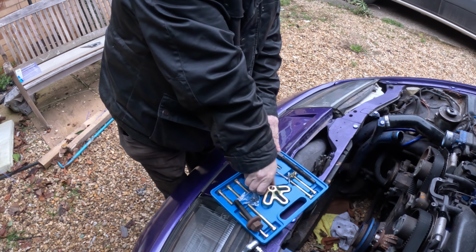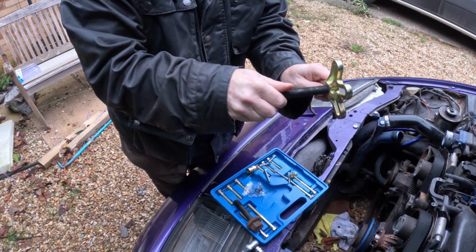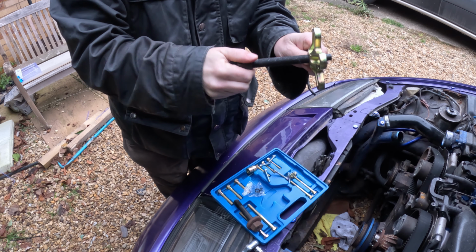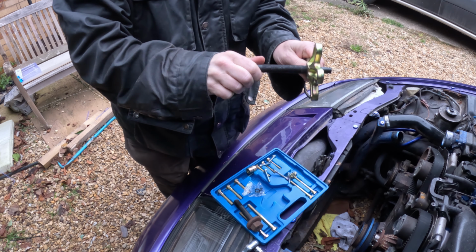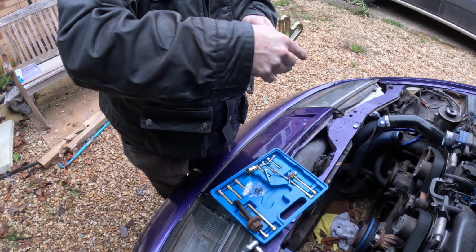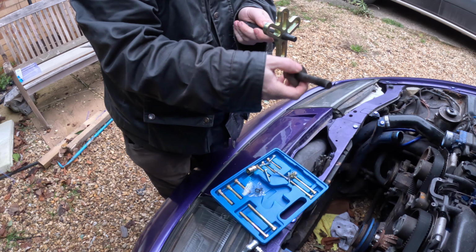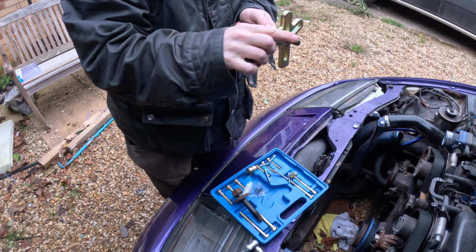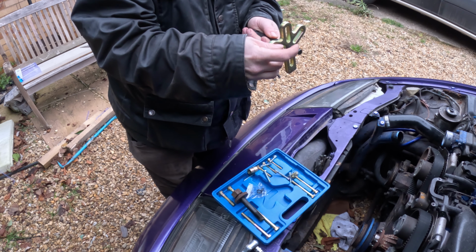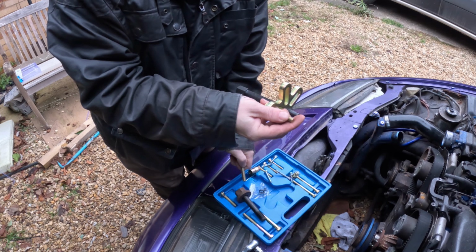So the way this works is you get this big bit here, and this big bolt, and the big bolt will go through the center of here like so, and in the center of your crank pulley you're going to have the crank what comes down there, and the original bolt will thread in the middle of that like so, and then on the crank pulley wheel there's going to be a thread there and a thread there. And what you're going to do is put the bolt through each side, these move backwards and forwards like that, into each one like that,